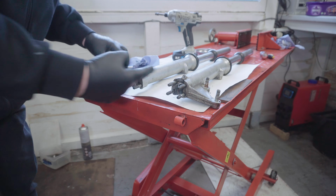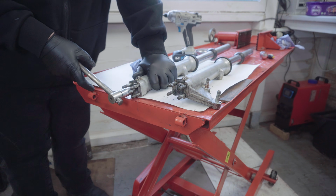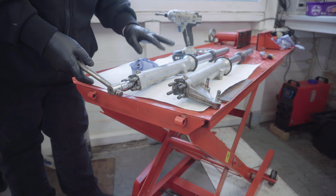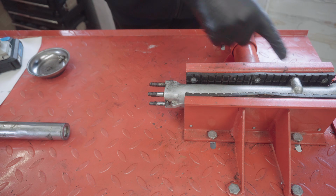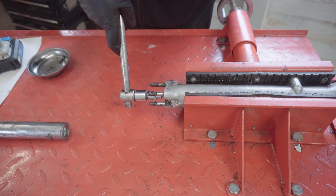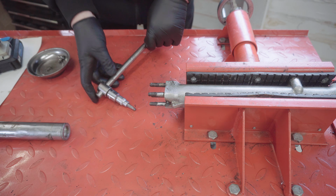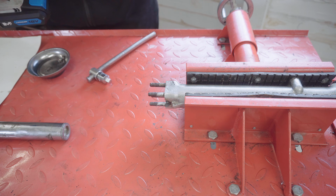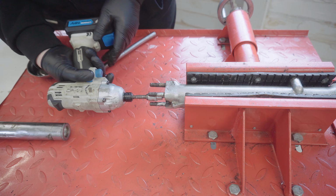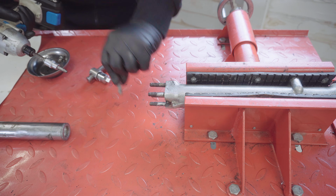The screws themselves actually do go through into a steel part inside, and this is where I wish it was still on the bike, because you can put a bit more leverage in before you're defeating yourself. See what I can work out. Well, let's see if this works. It's actually held on the bosses for the mudguard. What you don't want is the part inside swivelling round, which is what the special tool stops.